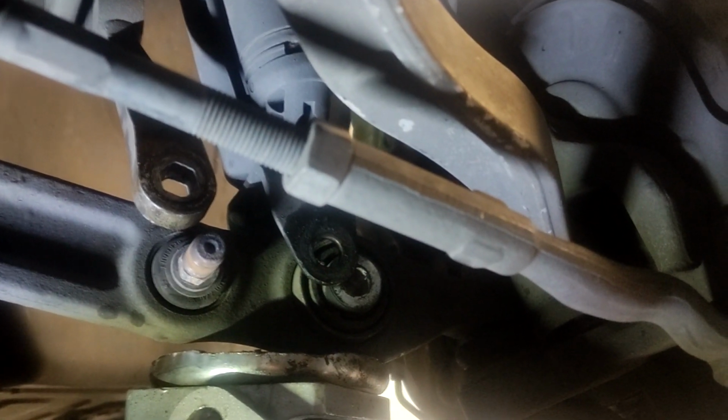But basically, to get this off, there is the sway bar nut here, the 21 mil, and same over on this side, it's a 21 mil bolt with a nut to get the shock off. I put a jack under here to support this, because once these bolts are out, this arm just moves with the whole spindle, so it's actually easy to do once you get these 2 bolts off. And I didn't do anything special for the air suspension. It is just at regular ride height, I jacked the car up and started working on it.